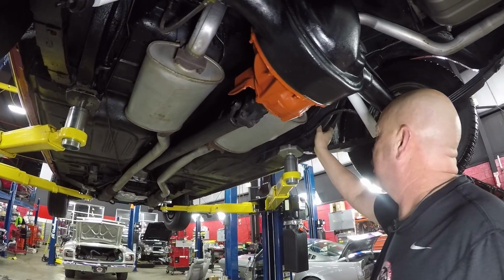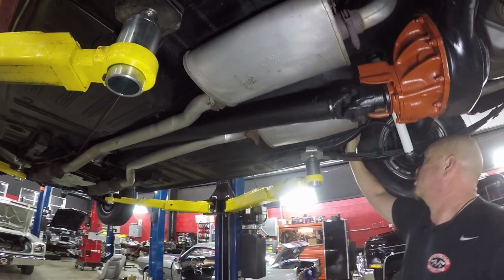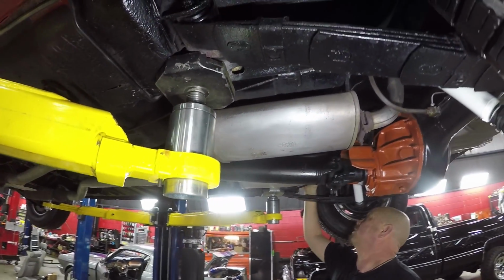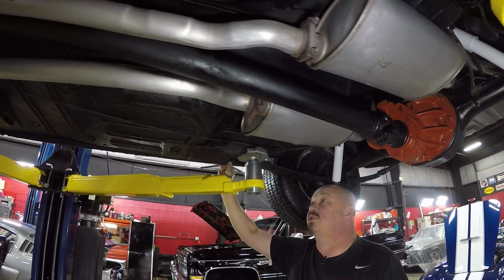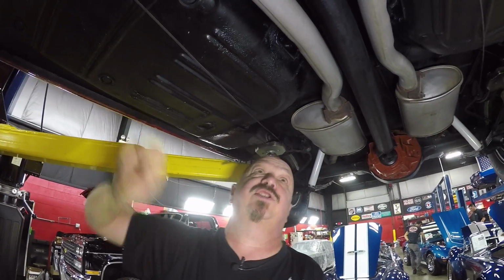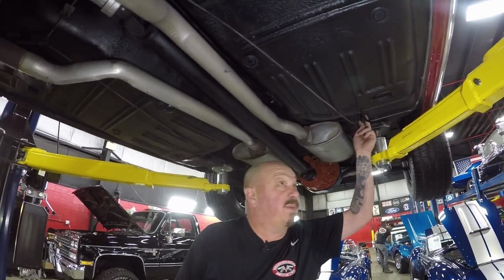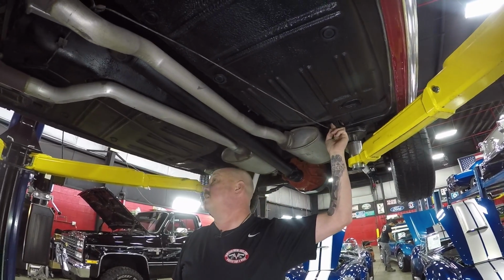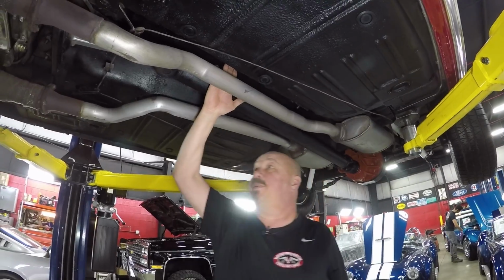And again, this is another picky area on the frame you want to look at on every one of these Mustangs. You also want to look at this pinch weld here where that inner wheelhouse goes to the floorboard and the trunk. Of course, you got to look at the pinch weld here on the bottom of the rocker. It looks good. Floorboards also look like they're original to the car. Now the fuel line running front to back looks like it was replaced at one time. The brake line looks like it's original but in great shape up here in the tunnel.